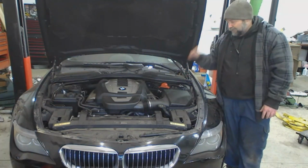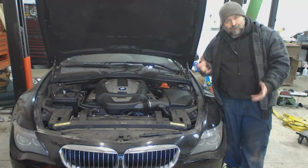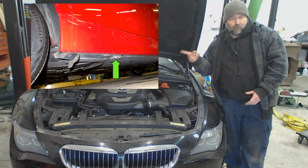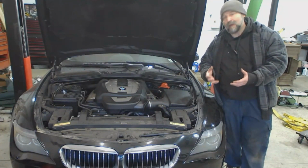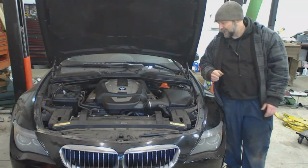A couple of things. First off, if you guys get one of these or any kind of BMW, most of them are not made to be lifted by the pinch welds. They have these specific lift points like this. And to use the lift points, you need to use some glorified hockey pucks that are made to register in those lift pads. They look like this. I'll put a link in the description if you guys want to find these.